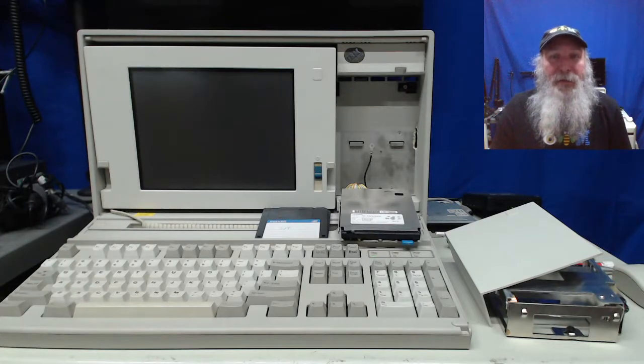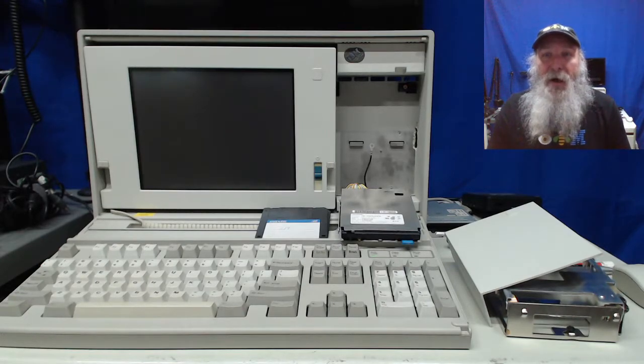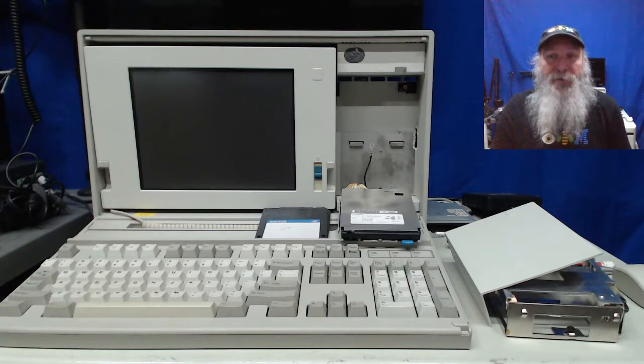Since it's a 34-pin drive, I can plug in that little adapter. There's a process documented — Lewis Olin diagrammed all that out, gave instructions and pictures of how to do that years ago — to get those diskette drive components out of there to be able to replace the diskette drive. It's not a very involved process.